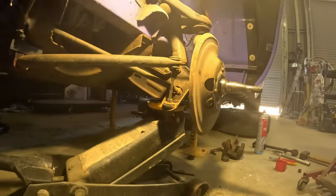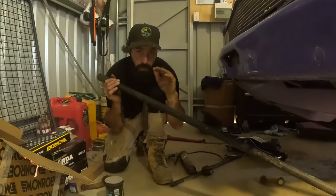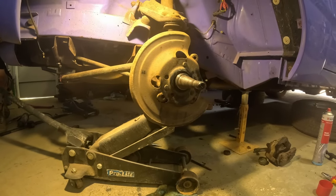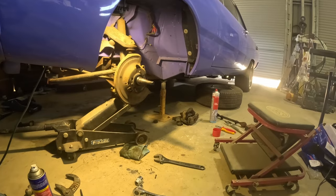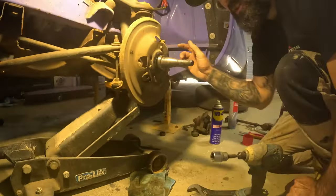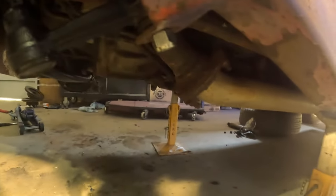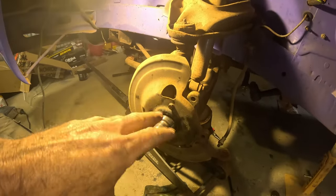Basically I'll jack that up until I can see the load of the car starting to be lifted. I don't want to lift it off the stand, so I'm just going to lift until I can see it starting to move and stop there. Don't forget to spray everything with WD-40 because it helps a lot when you're undoing these old bolts, especially rusty ones. If you don't know what torsion suspension is, it's just a big springy bar — that bolt there puts tension on that spring-loaded bar, which creates downward force and that gives you suspension. That's why you can see people raising or lowering the height of their car just by undoing that bolt, but generally you shouldn't do that because it ruins your whole ride experience.